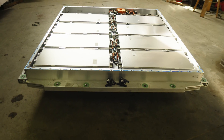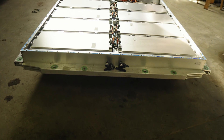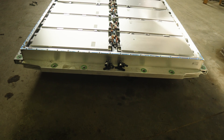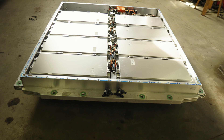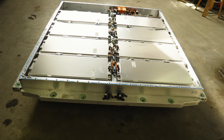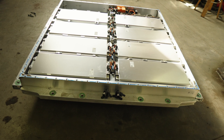From the front side of the pack there are the coolant connections. This entire bottom is just a chill plate, so these modules are cooled from the bottom side only — versus the Tesla which has the ribbon cooling throughout the canister cells.